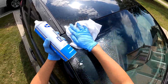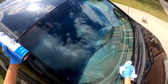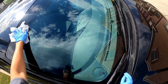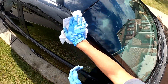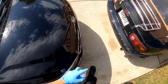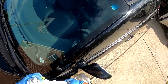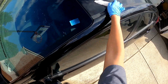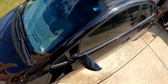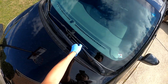Very simple, easy profit job. Should take about 30 to 45 minutes if you're quick and know what you're doing; if it's your first time expect an hour to an hour and a half — no rush. The best method to cut this windshield is the string method, whichever string machine you have. The wire method can also work but will be more aggressive. Try not to leave fingerprints or tape on the body. If they have oil stickers or any other stickers, ask if they want them moved over — you don't want to drive back for that. Make sure your wipers are tight by giving them a little shake to confirm they're both moving at the same time.